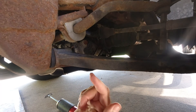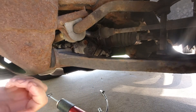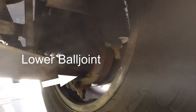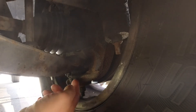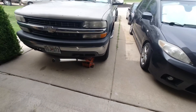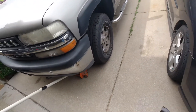If you go into your manual you'll find all the grease points, but I'll give you several of them here. Right there is your tie rod end. On the ball joints there's a grease fitting upper and lower, and there's a grease fitting up top as well. To show you the grease points on this Chevy pickup truck, we're going to take off this front driver's tire.